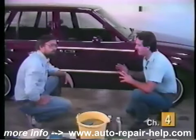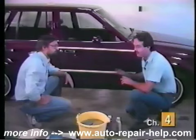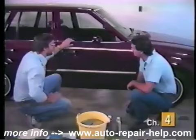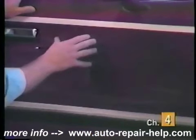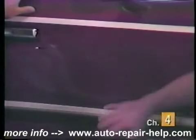We've finished our final coats of paint and we've allowed the paint to dry for a couple days before final finishing. What's our first step here now? What we'd like to do is take and color sand and rub out this area that we've blended into to make the texture as smooth as the original finish. I noticed a little bit of roughness in our new paint, so we're going to match that to the old stuff now.